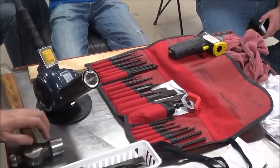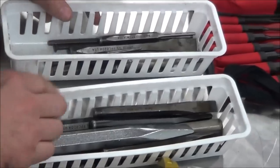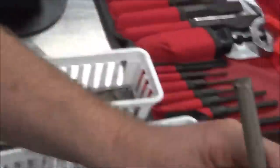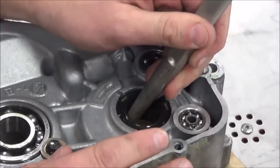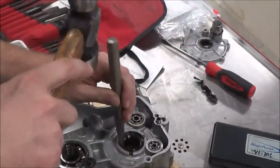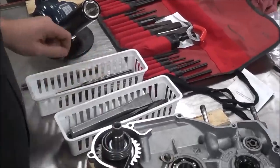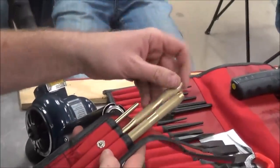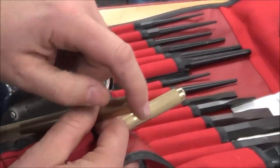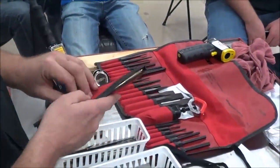You can see here a bunch of different types of punches. Another thing I've got here is these little totes from the dollar store or Walmart — I really like these for storing a bunch of tools in your toolbox. I've got some chisels and I'm looking for some nice flat ones. I want to see if I have enough grip when I heat that bearing to go back and forth. One of the other things you're eventually going to have to have is a brass set. Why would you want brass? It's soft, so it becomes a consumable tool. As it wears and flares out you can grind it off and dress it flat again, but it'll wear instead of hurting other parts.